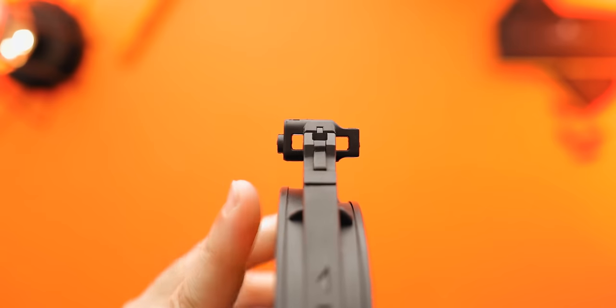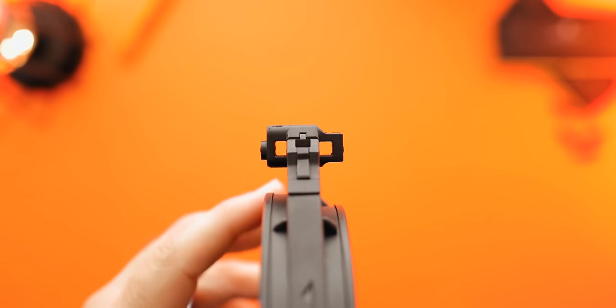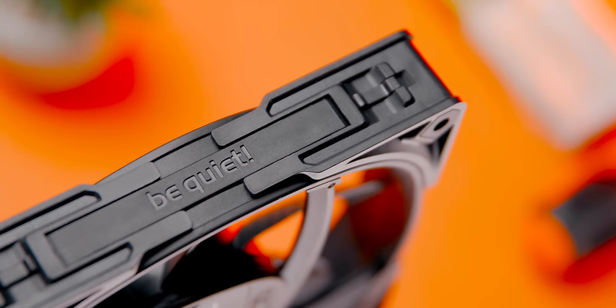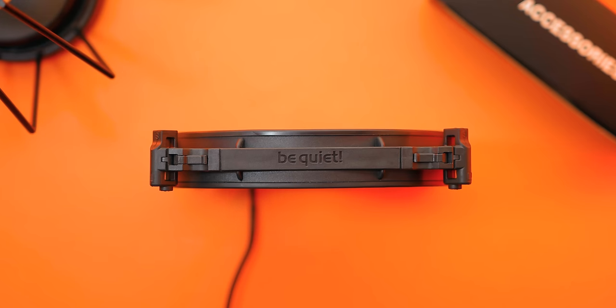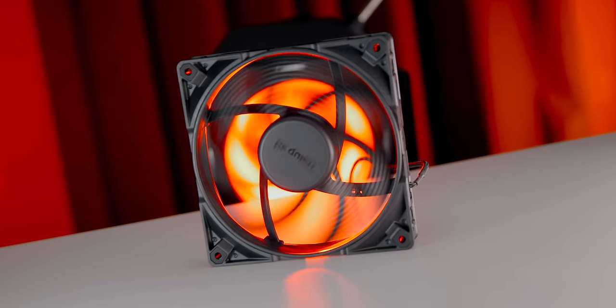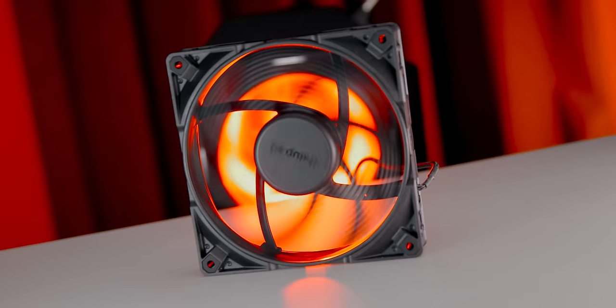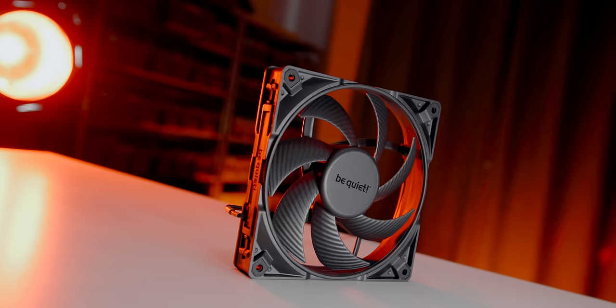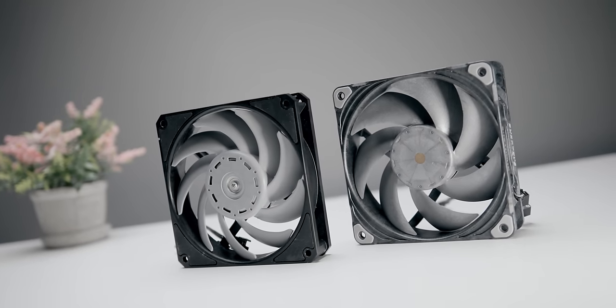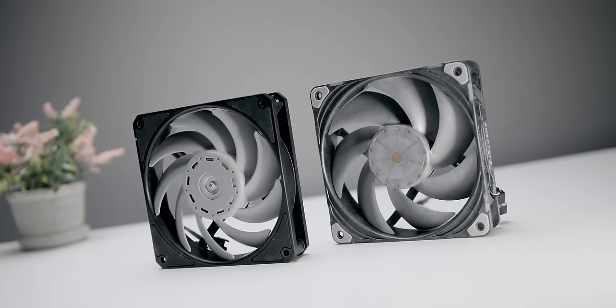This anti-vibration mount is actually reversible — the L side allows a one millimeter gap, while the S side brings everything completely flush. And this is actually one of the heavier fans I've come across. It's built like a weapon, but sticks to the standard 25 millimeters of thickness. All this makes it laser focused on delivering the best performance possible on radiators and heat sinks without any thickness trade-offs. There's also a 140 millimeter version available, which gives it a serious leg up on a lot of other high-end high static pressure fans like the Gentle Typhoon and the Phanteks T30, which don't even come in this size.